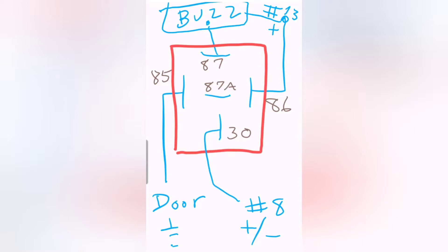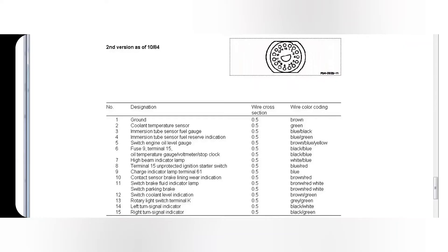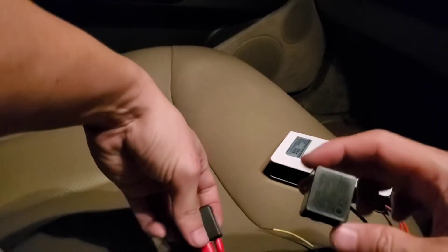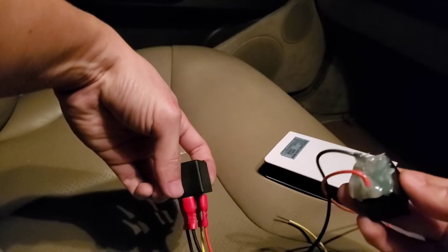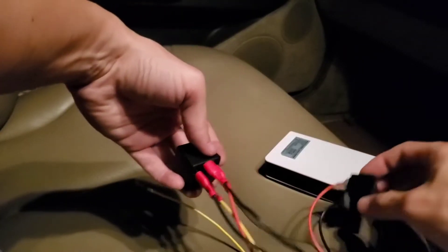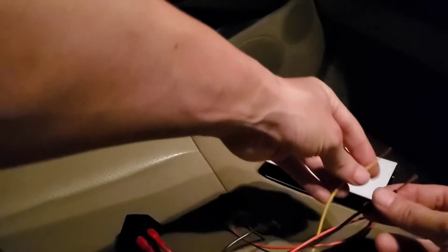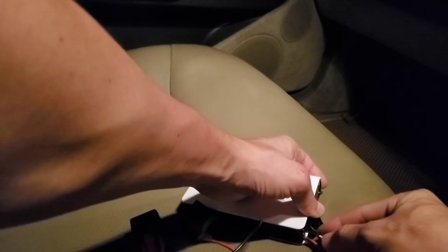Here is the wiring diagram. Number 13 is from the round plug that is hot when headlights are on. Number 8 is hot when the ignition key is on, and ground when ignition is off. This connector diagram is only for the newer dash with the built-in buzzer next to it, for your reference, but I don't need it because mine is the older gauge. Once you connect the buzzer with the relay as the diagram shows, test it — it should buzz as you apply 12V power and ground to the 85 and 86 poles of the relay.